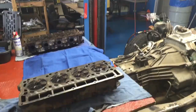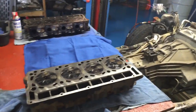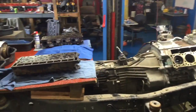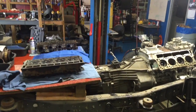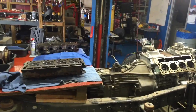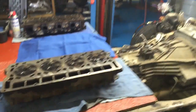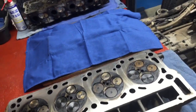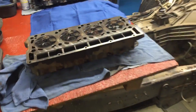You know, lapping them in. We got to lap them in. Let's not forget the basics. Yeah, we got these nice cutters. I got some new 5-angle cutters back there that I can do a 5-angle valve job. But let's not forget the basics. We can have all the coolest stuff in the world, but lap the valves in. Make sure they're good. That absolutely makes them good. And then final clean after we lap them. Then assemble them together, set the stem heights, boom, there you go, done.